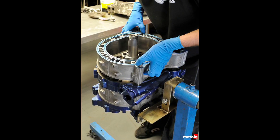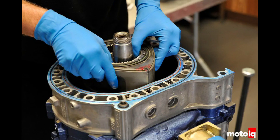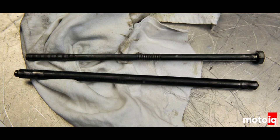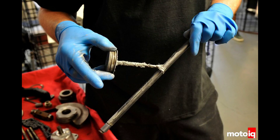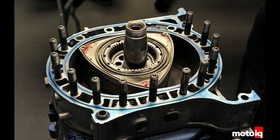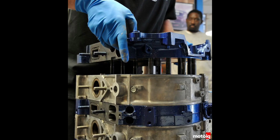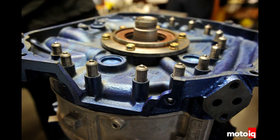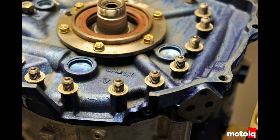You can see in a little bit of the assembly here — very straightforward. We did stud the block. It is RX-8 rotors. We had to deepen the RX-8 rotor grooves, so we ran full-size traditional 13B apex seals, as well as studding the block, to help keep any type of expansion, cracking, or fatigue from happening. I really recommend studding your block, whether it's an RX-8 or an RX-7, to help create a reliable boosted platform. It significantly reduces block twist, block stress, block expansion, and really helps your motor last a lot longer.